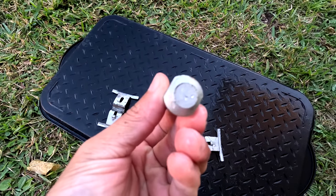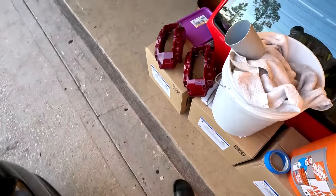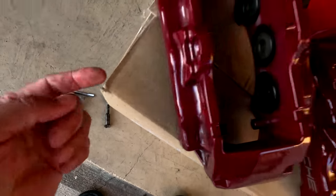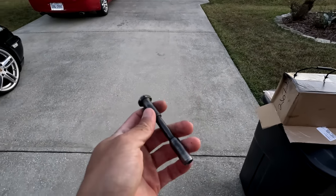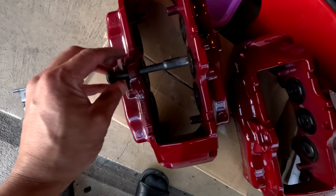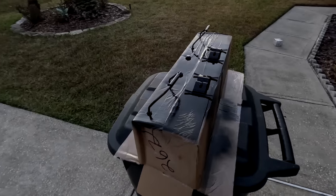I don't want everything brand new and powder-coated and then put crusty pieces back on. These sit right there front and center, so they need to look good. Gloss black, gloss black, gloss black — it'll all tie in nicely. For the slide pin, my original plan was to paint the entire pin, but I realized that's a bad idea — if we make it thicker with more paint it won't slide through properly, and the pads have to slide down it. So I just cleaned up the whole pin with scotch-brite and will only paint the top section black.